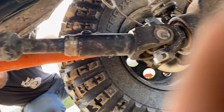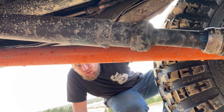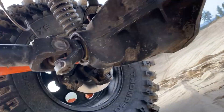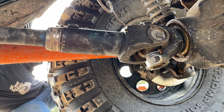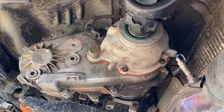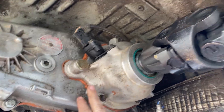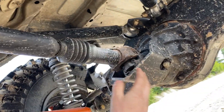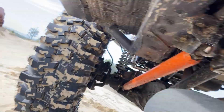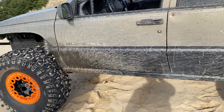Who did your driveline — did you make these yourself? Yes, I took stock fronts and stretched them. You can see they're sleeved, so they're probably quarter-wall two now. They're 1310s still. I want you to do the 1330 swap for sure. What t-case is this? It's a 231 with the SYE. Another custom driveline, pinion support — really nice stuff. This thing gets sent hard. We'll throw up a montage of him out here destroying it, really putting it through its paces.